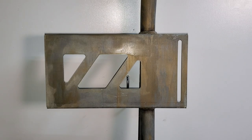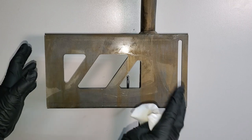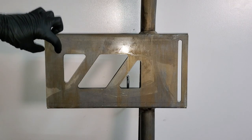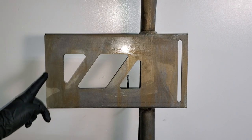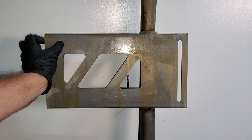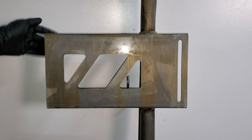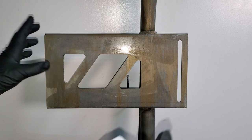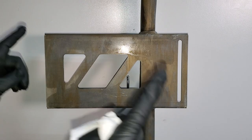After that dries, I'm going to start masking because this section of steel I still need to weld, and I don't want paint there. I'm going to use about a one-and-a-half-inch piece of masking tape around all the areas that I have to mask for welding. Then we'll go to the next step, which is going to get nuts here.